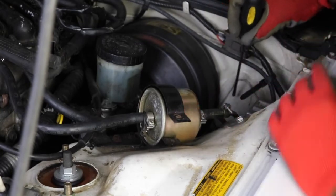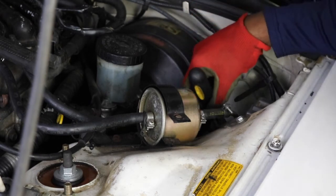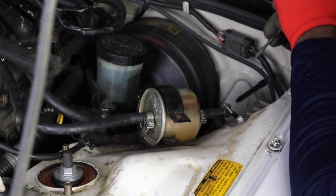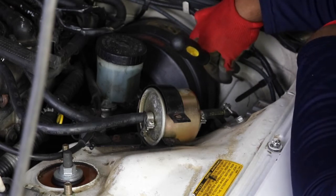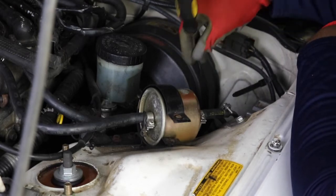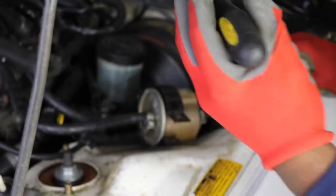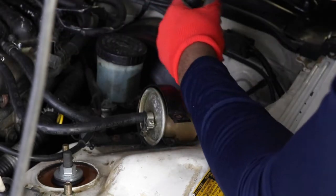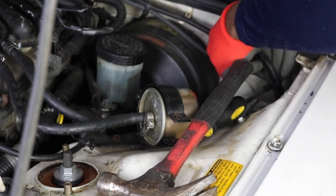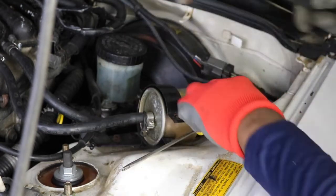There's a plate right here that has 2 spot welds in it. So pretty much every car, whether it's automatic or manual, comes ready to do either one. So they spot weld this plate on here to cover up this hole, which is where your master cylinder will go. So just some glue and these 2 spot welds. So I'm just gonna try to chisel. I got a better screwdriver than this, but I'm gonna try this one. So let's see if this works. So just kind of clear a little way. Got this plug out of it right now.